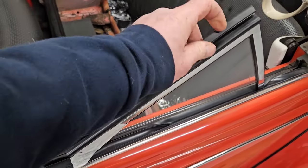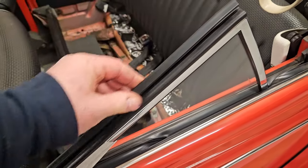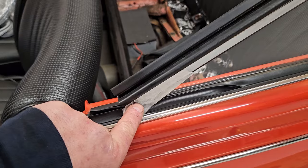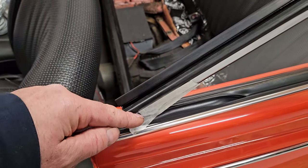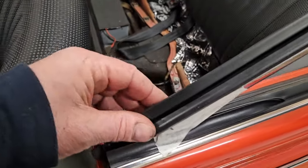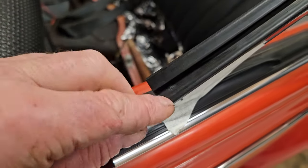I've got our rubber onto the rear quarter window. I slid this up using a little bit of maintenance spray — it slides in from the bottom, so just make it a little bit easier with a little bit of lubricant, and it slid all the way to the top. It has a fixing screw and a little plate that fits up inside the rubber, and the screw goes through into the frame. I've marked the screw hole with a piece of masking tape and a pen so I know where the hole is. With a sharp screwdriver I've pushed through the front and back of the rubber so there's a hole all the way through. Then I slide the little plate up inside, put the screw through the outside of the rubber, and stretch the rubber over the top of the screw head so it's hidden. The only other way is to pop the screw up through the centre, but I found that can end up splitting the rubber, so I found it easier popping the screw right the way through the front.